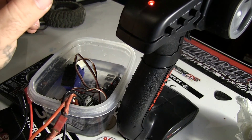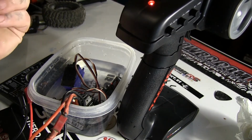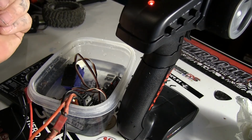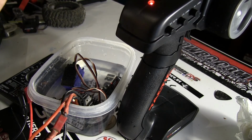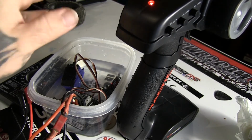They make it for a lot of electrical products. A lot of people use dielectric greases on their tail lights for their cars to keep moisture out. They put it on the plug-in of the bulbs and put it in there. But a lot of your marine greases as well are non-conductive, and the marine greases will withstand the moisture even longer.